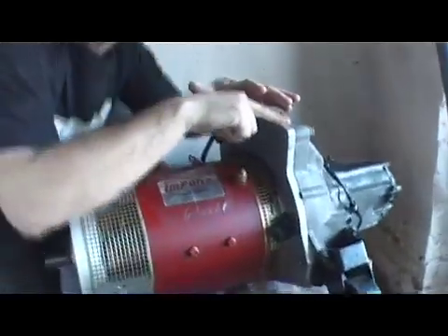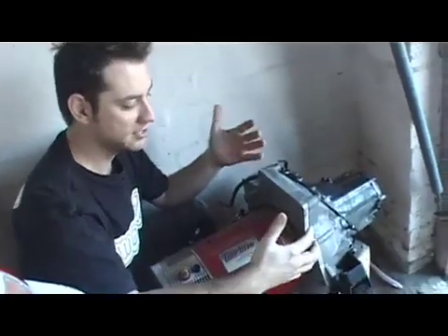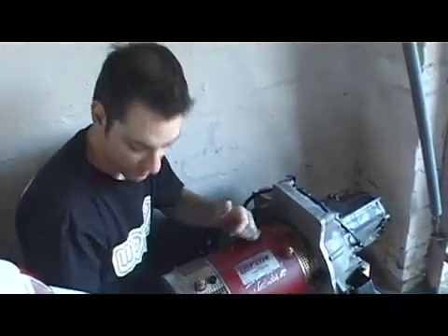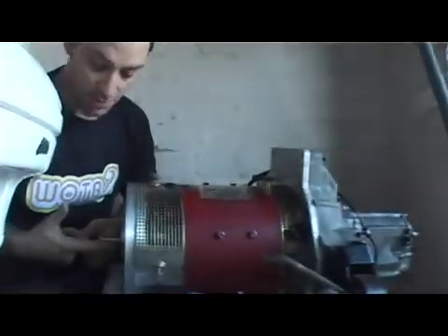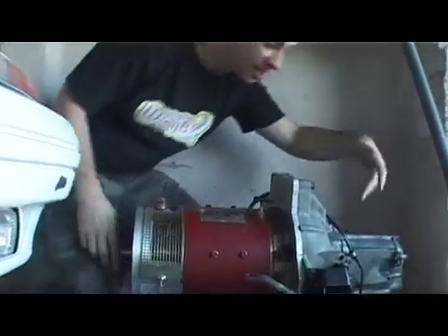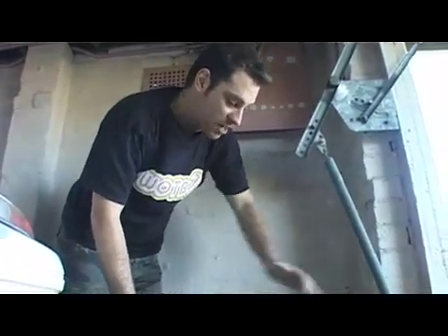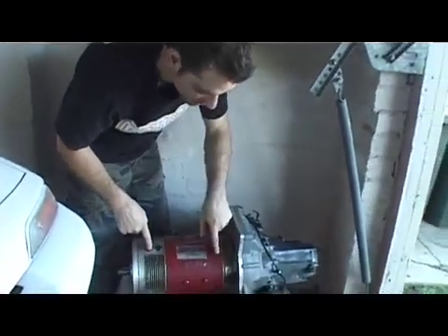This is really the main bit of tricky fabrication that you're going to have to have made when you want to match this up to your existing gearbox. This plate — let's call it an adapter plate — is simply something to bolt the motor into that then can bolt onto that. It's no more hardcore than that. If you have a look here, you've got a little spline. I can actually turn it with my hand. Try doing that with a normal petrol motor. There's another shaft on the other end of this which goes into the gearbox. So when the motor turns, the gearbox turns and works just like before. The two shafts that I had trouble getting out of the car — and Rob beat it out — join into that. So it's real simple. Battery terminal there, battery terminal there — voltage, and this turns, which means that turns, which means the wheel turns. It really is that simple. I hope.